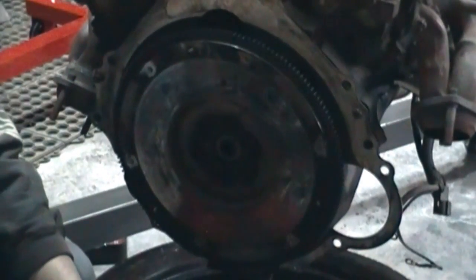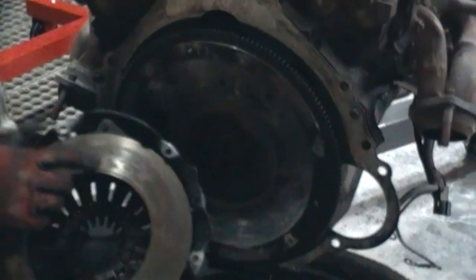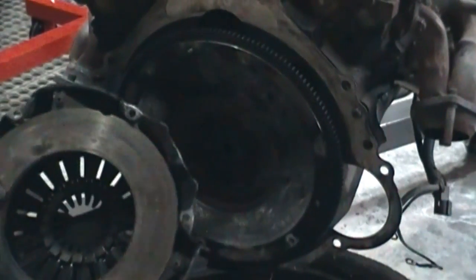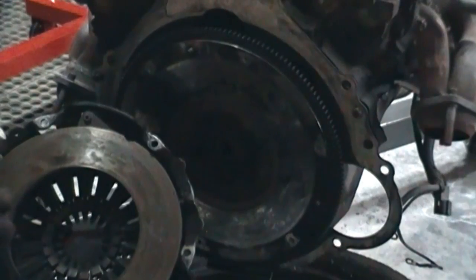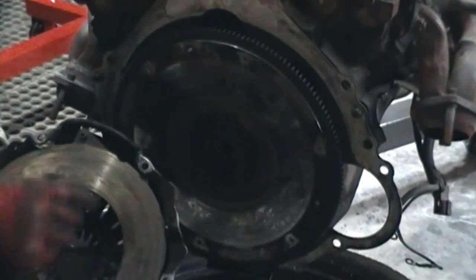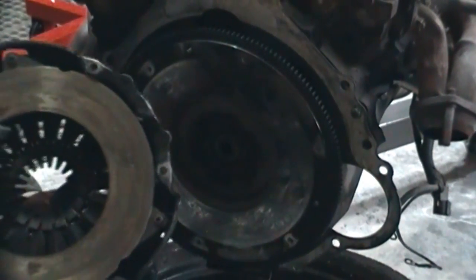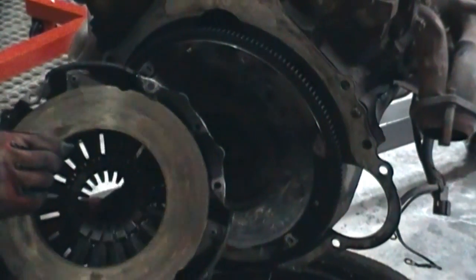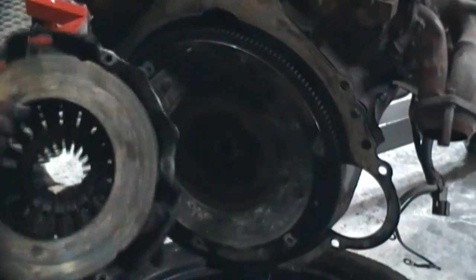And then if I show you the back side of the pressure plate, you can see a similar thing. It's got hot spots all the way around it, and obviously that one puck that was missing is basically doing metal on this, grinding away. Thankfully the rivets weren't taller than the clutch pucks themselves, but you can see all the hot spots and everything else. So these have been well used, well worn.